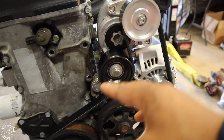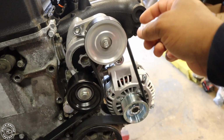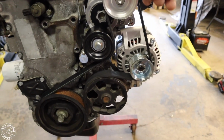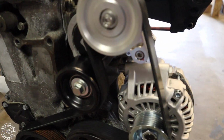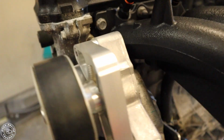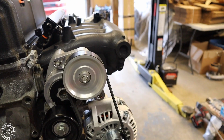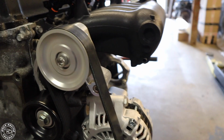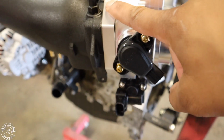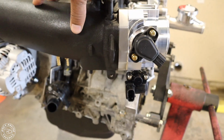So if you got the JDM stuff, the belt that's provided with this kit will not work. It will be a little bit smaller and you'd have to go to O'Reilly's and get a bigger one, or whatever. But you could purchase this power steering delete right here through Toyonda. The link will be in the description. It comes with the belt, and then you just have to install this on your motor, and then your power steering will be deleted.